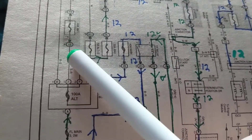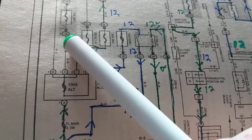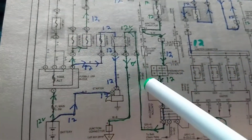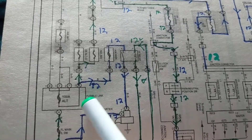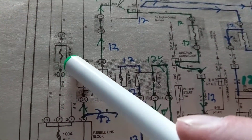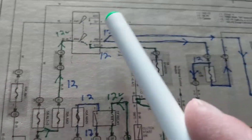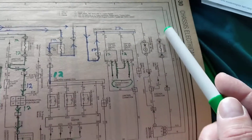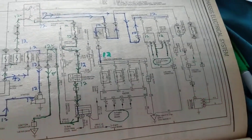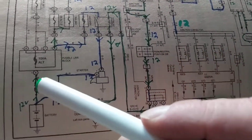Let's take this path — we go out here, and this goes to a 100-amp alternator fuse for the alternator. If we come up here, this path is going to lead me to the alternator. I'm not really concerned about the alternator — I have a starting problem. The alternator is after you start the car. We have a no-crank problem over here. Going through ignition switch two, the black and red wire comes out, going through fuse A, pin two coming in, pin one going out, a 40-amp fuse — when we close it we come to the alternator. That path is not good for us.